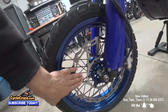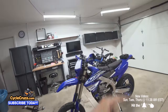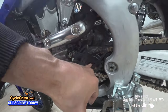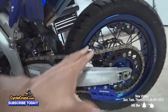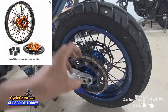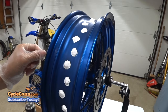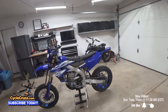These are Warp 9 Racing supermoto wheels and they've been awesome — no problems. They come as a kit with a 320mm brake disc rotor and adapter kit for the front brake. It also comes with a rear sprocket — I went with 44 teeth. The counter sprocket is a stock 13-tooth, and I went with a Renthal chain that's exactly 112 links with a clip-style master link. The wheels also come with a cush drive — rubber dampeners that reduce stress on drivetrain components. What's great about Warp 9 is you can now get them tubeless from the factory.